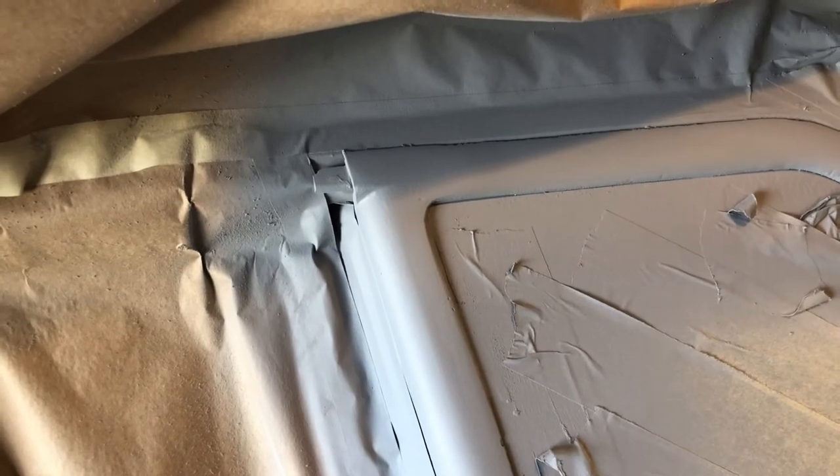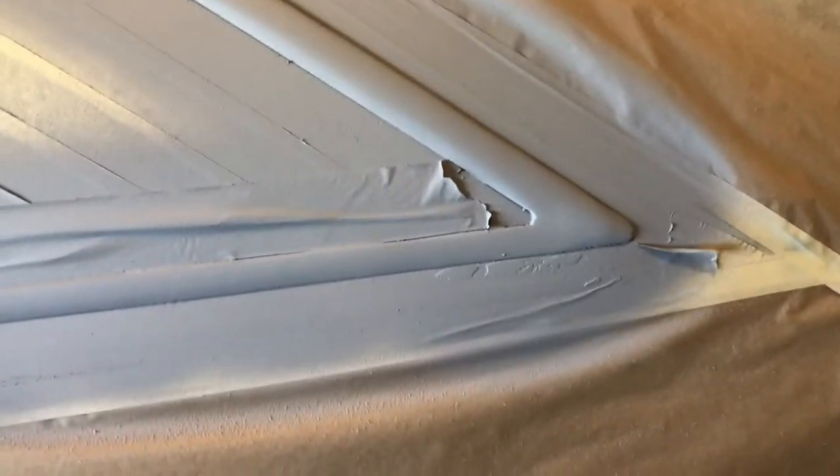This is actually the second coat of primer. There are a couple little spots I probably could fix but I'm just not gonna. There are tiny little pinholes but for the most part it's all nice and back to looking original. One thing you want to do is recreate that texture — thicken up your primer a little bit. You can't sand texture, you have to create it with the spray. When I spray the black part, I'll make it a little thicker or turn down the air pressure. With a rattle can, stand back a little further to create more dust texture.